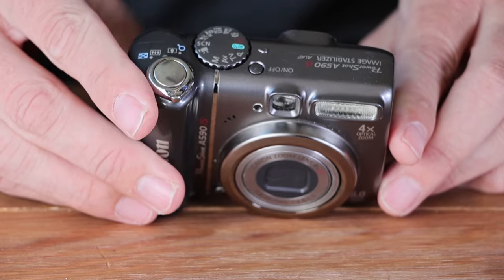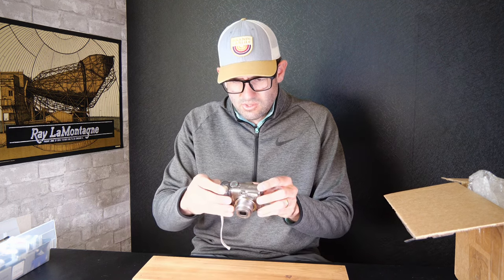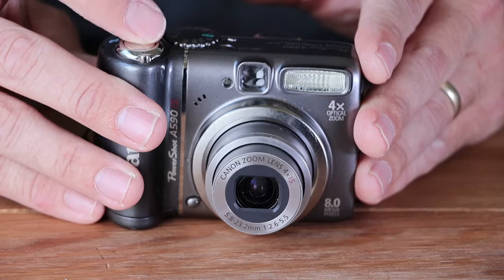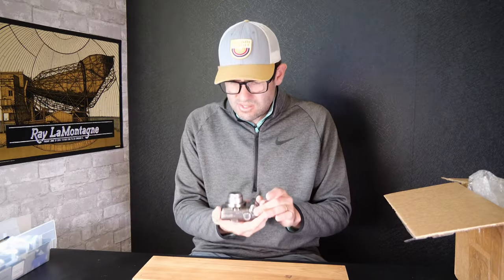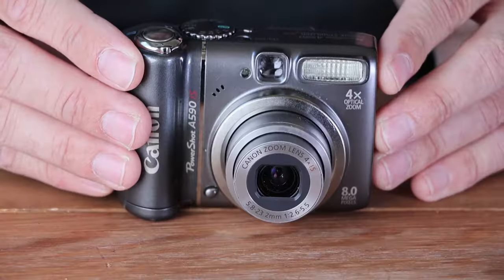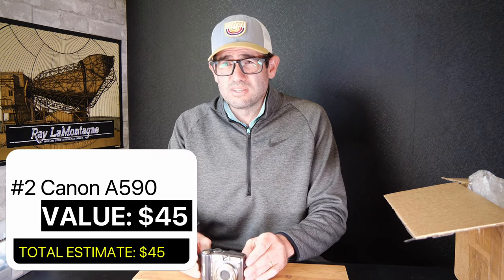Power's on, lens moves out. I actually sold this camera when it was originally released by Canon. Lens noise is a very common thing with older Canon PowerShot cameras. The lens appears to be working fine. LCD has a little bit of wear. Flash fired, autofocus is working properly, and there's nothing inside the lens affecting image performance. That looks good — just needs a little bit of cleaning. With just a minute of work cleaning up this camera, we now have it in working condition. Paired with a memory card and USB cable, you're looking at a value in the $45 range on this camera, even with that lens noise.